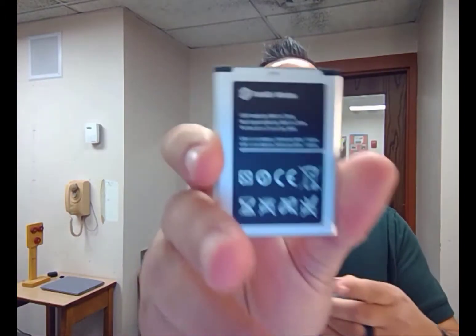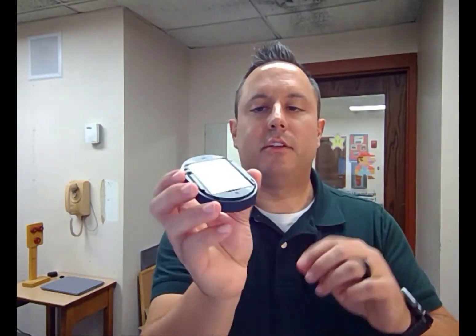We're going to reinstall the battery. Taking the battery out of the package, I want to line up these three silver connectors with the three silver connectors on the device. This side says 'up,' so I'm going to do that — slide the end with the three connectors in first. Now I'm putting the cover back on. Before turning on your Jetpack, charge it fully using the charger that came with your device. So I'm going to charge it up and then I'll be back.